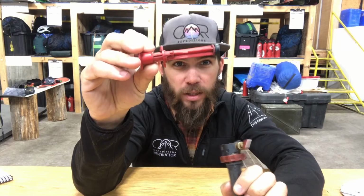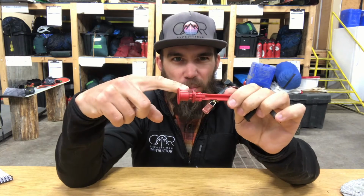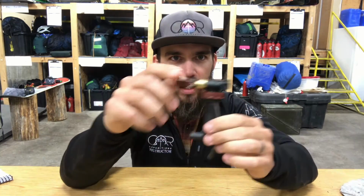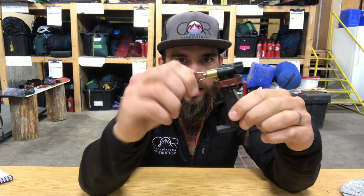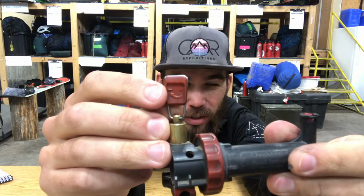First, we're going to talk about our pump mechanism, the basic parts of this. Obviously, this shaft here is our pump shaft. And then down here on the bottom, this rubber guy is called our pump cup. And there's a little ring around here. When we take this apart, don't break that. And then basic anatomy of this guy, we've got our valve here. And it's got a handy dandy diagram on there if you forget which way it's supposed to turn when you're trying to turn your stove off. It'll have a reminder on there for you.